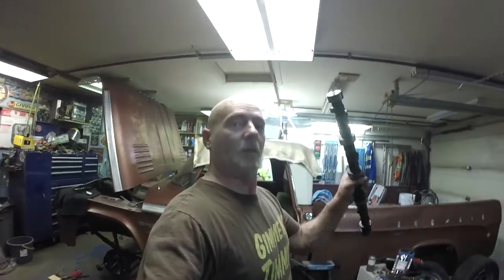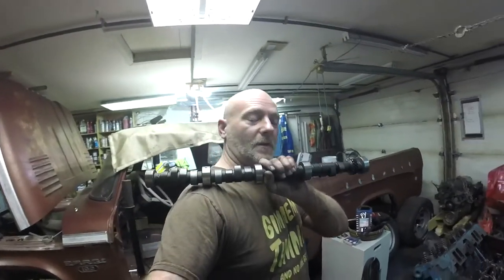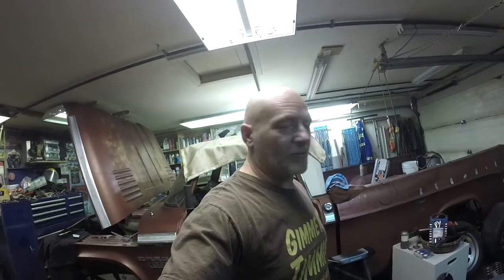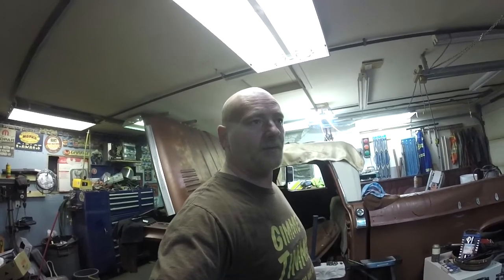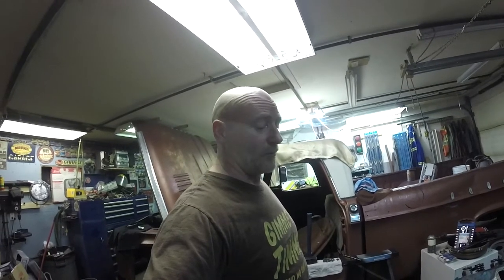So guys, went to put the camshaft in, and was doing a test fit off camera, and guess what? It wouldn't fit. I was immediately panicked that my El Cheapo Summit Racing camshaft was boogered, but what it ended up being was number 4 cam bearing, due to core shift, whatever. It stopped at number 4 basically. I could get it in about an eighth to 3/16 of an inch and stopped dead, like, oh man.